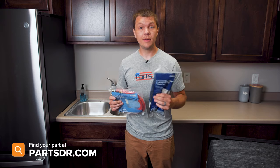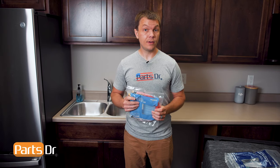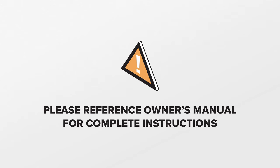With most dishwashers, they do not include a water supply line or power cord because they vary depending on each application. We'll leave a link in the description below to the two parts that we're using. In some applications, you may not need a power cord because the electrical connection is hardwired from the house. Always use a new water line anytime you're installing a dishwasher — never reuse an old one. Please reference your dishwasher's owner's manual or installation instructions for what is required. Some installation parts are universal and some are model specific.